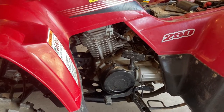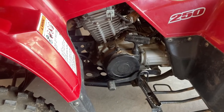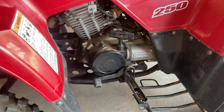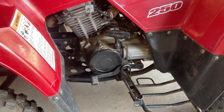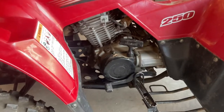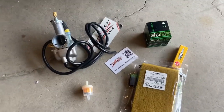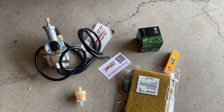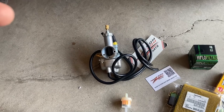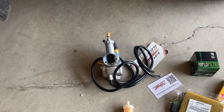Pull the air filter out. I've got a new carburetor that should go right on this. I've got everything unboxed here — a high flow oil filter, new spark plug, new air filter, new fuel filter. And then this is a knockoff cheap carburetor, but they do seem to work. They're a little Chinese version.